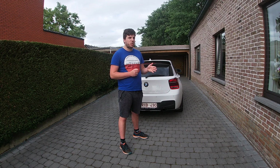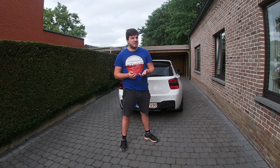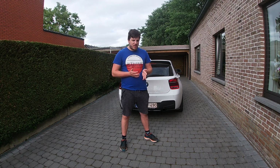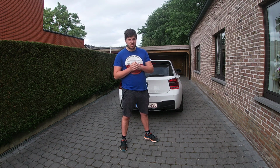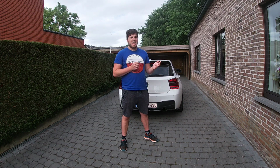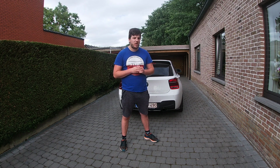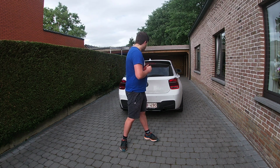And that's also the main reason why I wouldn't get a 125i, because the 135i is not that much more expensive, and you have a 6-cylinder, and you have an even higher stock horsepower output than a 125i with a stage 1 tune. And if you tune a 135i or 140i to stage 1, you're pushing around 400 horsepower, which is a lot more than the 270 or 300 from the car that you have.